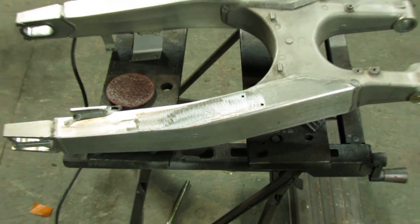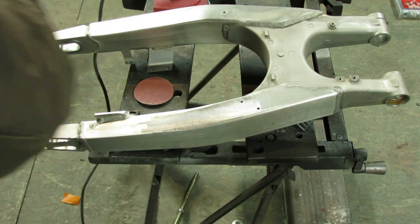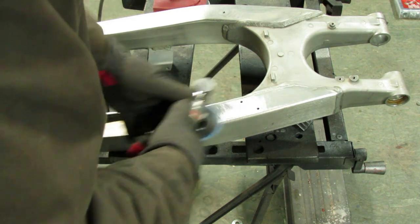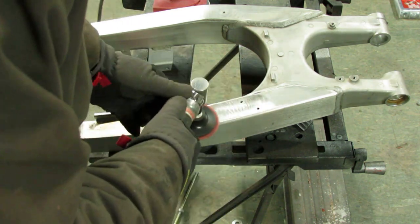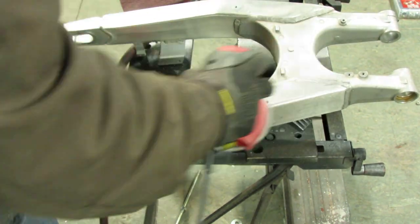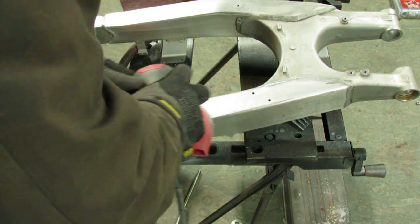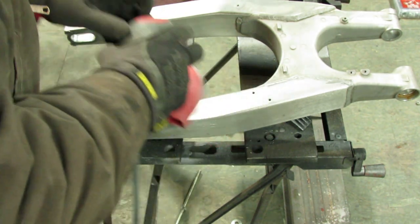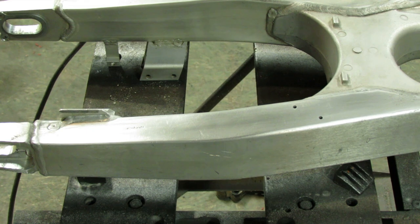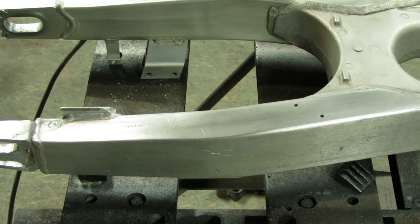You can see the scratch is almost gone — I'm going to keep going on it. As you can see, that scratch is mostly gone now. I'll probably do the rest of the swing arm where there's no scratches in the same 320 grit — there's no point putting deeper scratches in than you need to.